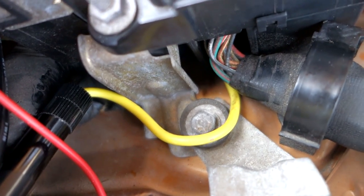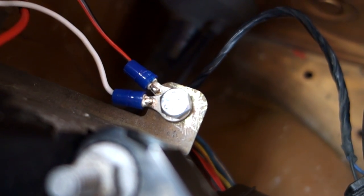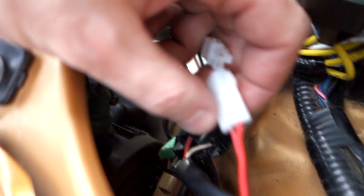Quickly to recap, we've got our control module sitting in here with the wire spliced into our battery line there. We've got our two grounds connected up here, and you can see there I've scratched the post nice and clean to make sure we've got a really good quality connection there. And then the cabling runs through the sill, down through a loom tube. The first side splits out into our right hand side headlight, which is plugged in here. And then it runs across the front through this existing loom tube for my headlight wiring, through the back here, and we just need to plug this in,